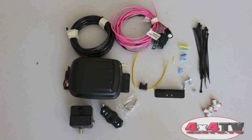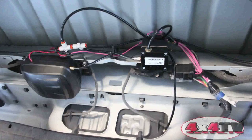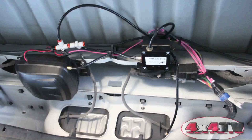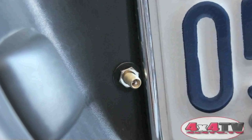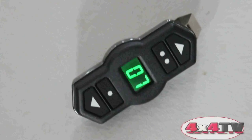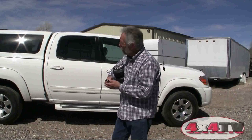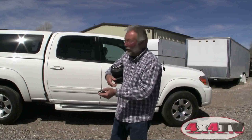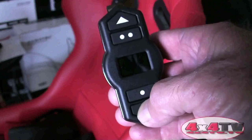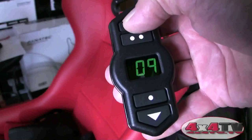When you put a trailer on it, you have control over how much air you put in the air bladders, which determines ride height and how it will tow that trailer. We also chose to use the wireless system, which is essentially a small onboard compressor that mounts on the truck and ties into the electrical system. It gives you the choice of filling the bladders manually with an air chuck or hitting the compressor with this wireless remote button. Here you can hook your trailer up and just hit this button to air it up — that's 12 pounds in there, which is perfect.